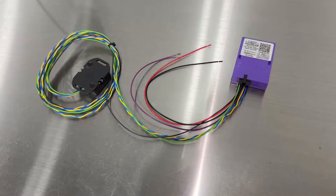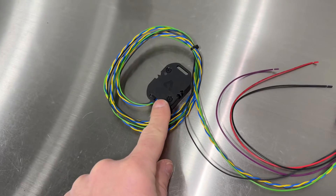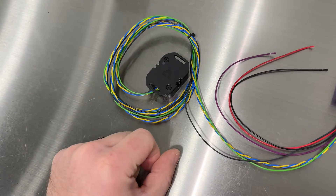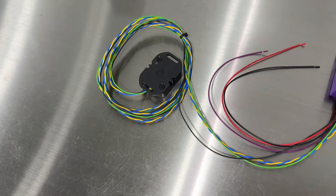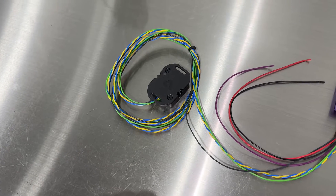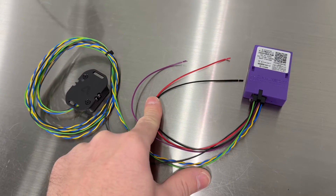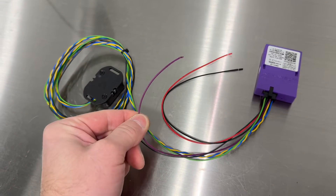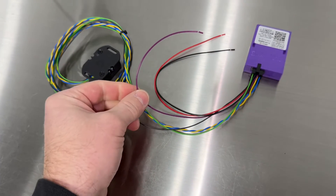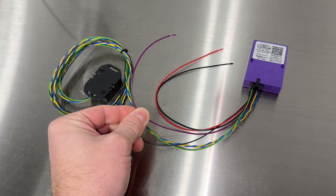Here's the CAN M8 module, and it's connected to a contactless reader — essentially a wireless reader. You feed the wiring through it, close it, and it's able to measure the signals that pass through the wiring and relay back to the module. The module connects to power and also has our output. You've got three wires to hook up, plus the trigger which is the high beam wiring, and this will connect to the Diode Dynamics relay setup. It's going to be super straightforward.